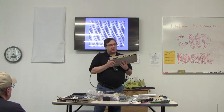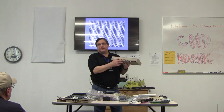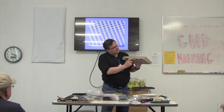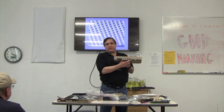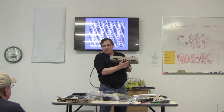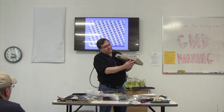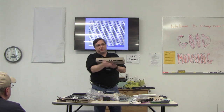The very first Commodore 64s only had composite video, but shortly after they upgraded to include chroma and luma outputs — which is S-video — before anybody else heard of S-video. That really made a big difference in picture quality. Next to that is the serial port for connecting a floppy drive or printer. Next to that is your cassette port, which most people used since they couldn't afford a floppy drive.